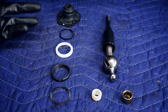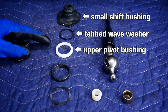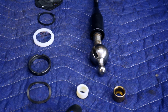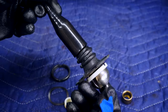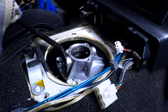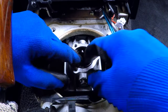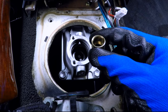Here we have all the parts laid out in order of how they go on the shifter. From the top: the small shift bushing, tab wave washer, upper shifter pivot ball bushing, lower shifter pivot ball bushing, and smooth wave washer. The kit includes a lower shift bushing, but we're going to use the bronze one instead. Over here inside the car, this is the top of the transmission where the shifter goes. Now we can install the wave washer and this lower pivot bushing, then push this pin back in to seal in the goodness. Now we can drop in the bronze bushing.